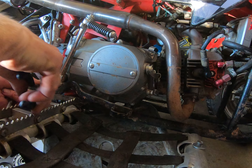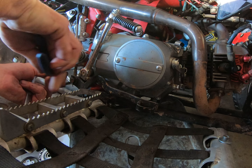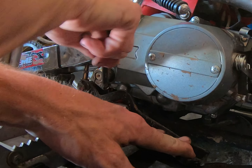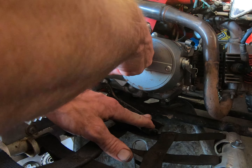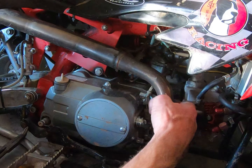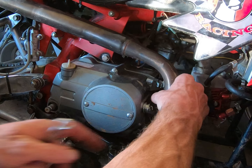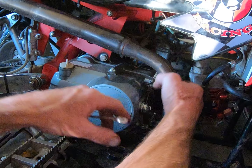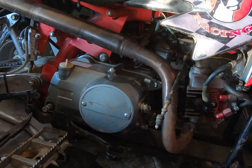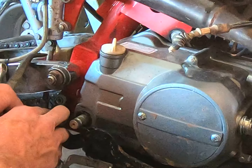We'll have to take off the back brake anyway - there's a cotter pin right here. Got the kicker here, I'm gonna pull it off, 10 millimeter on it. I loosened the clutch cable already, that should pop out with a little bit of aggravation, and probably be able to pull it out the top. I'm not sure if we need to take this off or not. Got a washer on there.